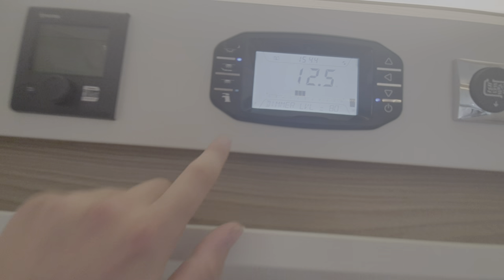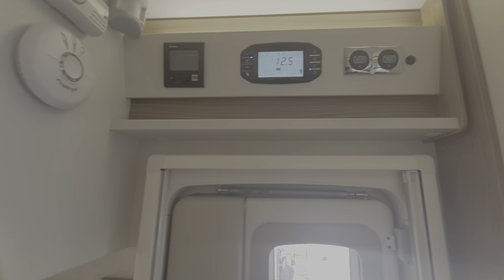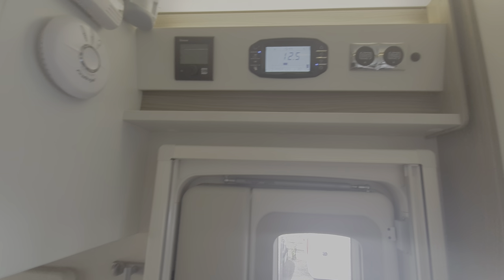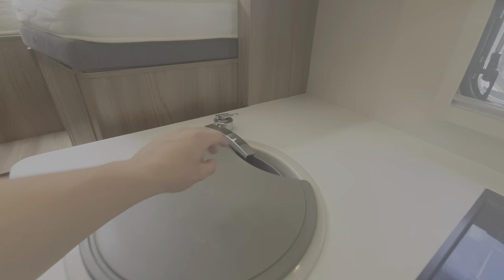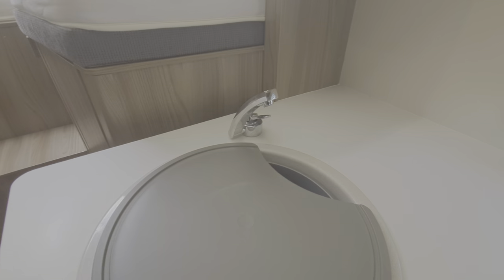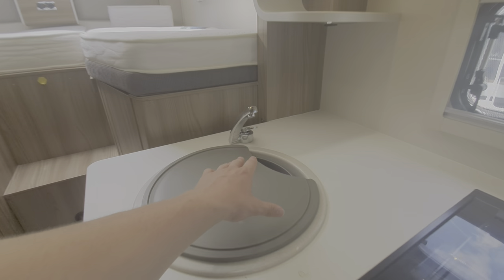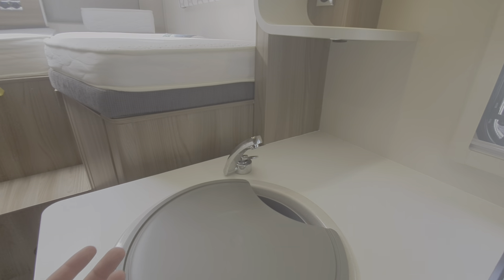At the bottom here, you've got a little icon which is the pump. If you click that, that will activate the pump. You'll be using that for when you've got water in the vehicle — only run the pump when you've got water in because you don't want to be burning it out. Once you've filled up the water in the vehicle, come to your taps, including your shower. With this tap, just flick it up and then you can turn it on. What you need to do is select your pump, turn all your taps on and turn it to hot. That will pull water from the fresh water tank into the boiler and then out of the tap. It will spurt and splutter, and then when it's running steadily, it has primed the system for the hot water.